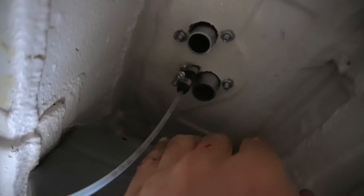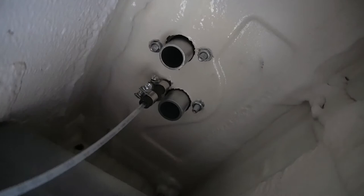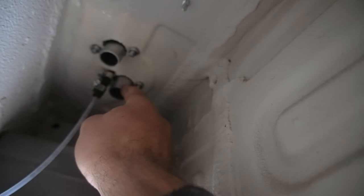If you notice, there's this gray box right here. On these newer vans, if you go on the passenger side, that's where your jack and everything is. I don't know if it's the same on older vans. It's a nice little area to put the air inlet hose so it's not hanging down. You'll get some dust up there depending on where you go, but the mud flap and everything is in the way. So that's where the heater will be sucking air from, and this will be the exhaust.